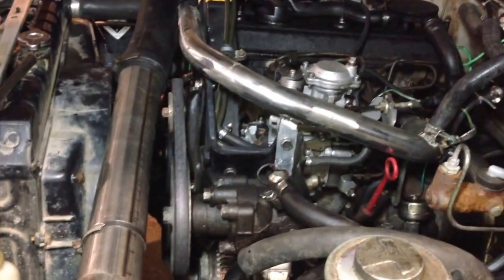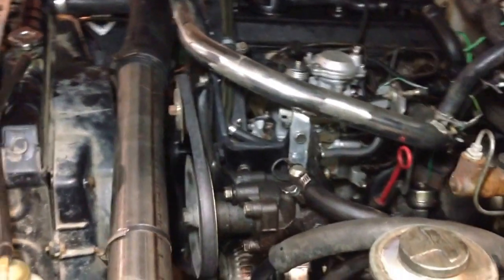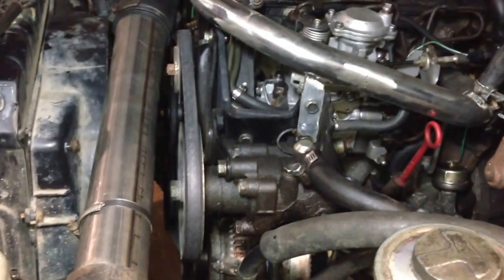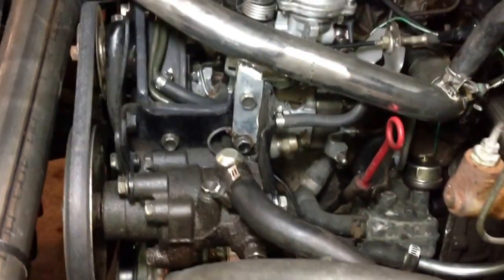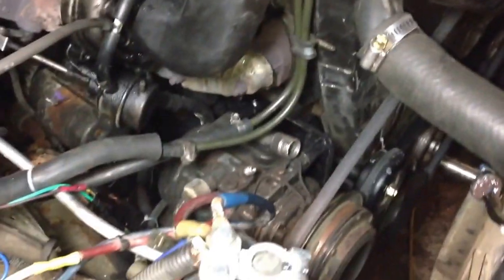And here it is again, the AAZ motor, which is the early Volkswagen turbo diesel 1.9. The new Autocrafters kit comes designed for everything Toyota to be put back in: Toyota alternator, Toyota power steering pump. The only thing that will be Volkswagen will be the injection pump, the long block, and the turbo. We even give you the adapter to adapt your exhaust right on to the factory exhaust. Toyota air conditioning compressor, Toyota everything.